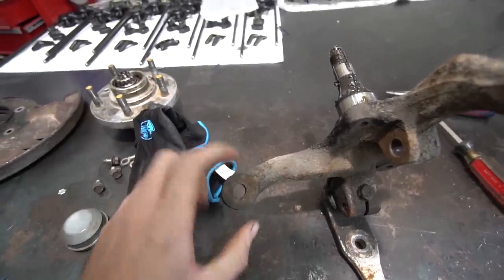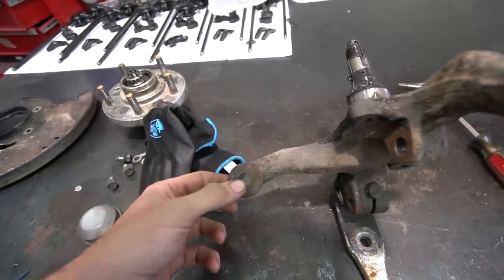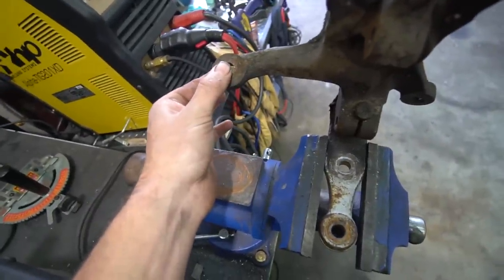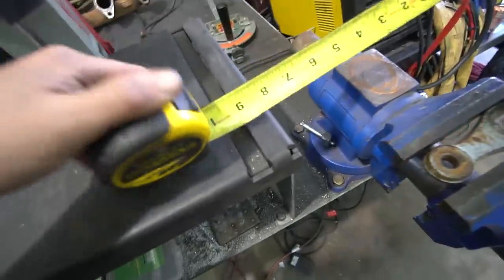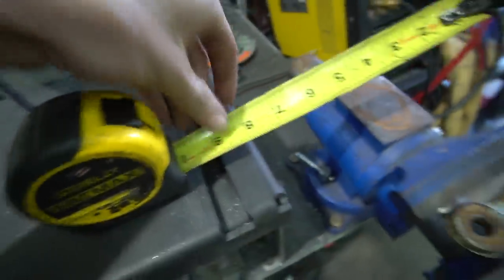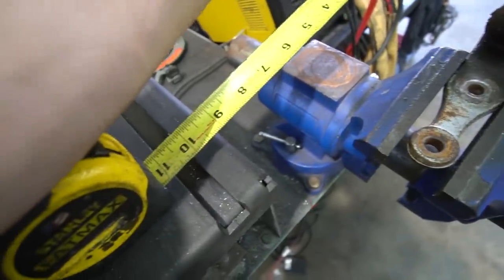Basically what we're going to be doing is moving this tie rod pickup point closer to the pivot point of the knuckle. So we've got eight inches to the bandsaw. If we go two inches, we're turned that far. Now we move this in here — so we're at nine inches because it's further in. We'll go to 11. It's a little tricky, not very scientific, but you'll get the idea. You can see that it turns further.